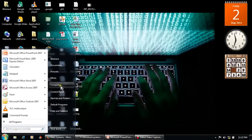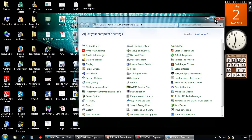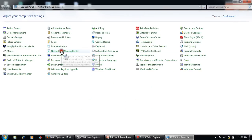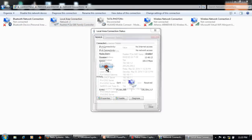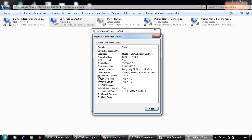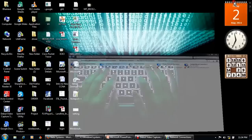Another process: go to Start > Control Panel > Network and Sharing Center > Change Adapter Settings, and check the status. Look at the IPv4 default gateway. If it is 192.168.1.1, there is a conflict. If it is 192.168.0.1, 192.168.2.1, or any other third octet, that is fine and no change is needed. But if it matches 192.168.1.1, we need to change the Netis device IP address.